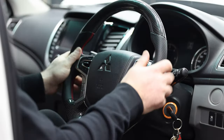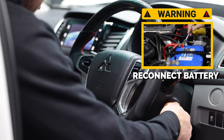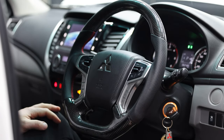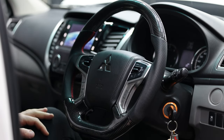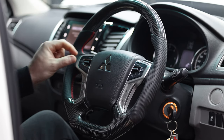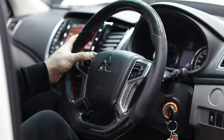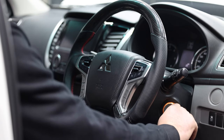Reconnect the battery, then we'll test. Turn on the ignition — we'll start the car as well. Make sure everything's connected, no fault codes on the dashboard. Once the head unit boots up, check the steering controls are all connected and working. Test all the buttons, make sure they all work — and that's it, easy as that. Thanks guys, enjoy.